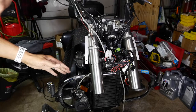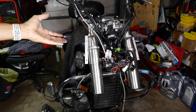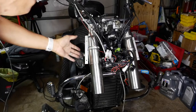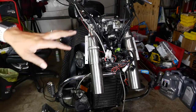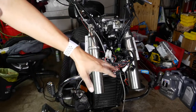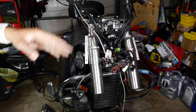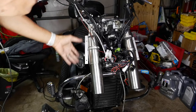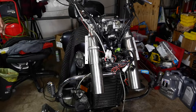For now we're going to snug everything up, and then we'll go into how I actually tighten everything up — all of this is in the manual. The manual tells you how to tighten the forks and we'll get into that. I also loosen up the fender, the axle, the pinch bolt — all that stuff — bounce the front end once or twice with the top tightened, and then go through the manual's way of tightening the forks so that any little tweaks sort themselves out. Let's get started — I'll set the camera up on a tripod.